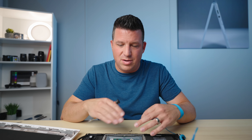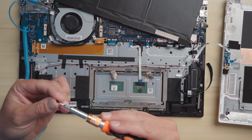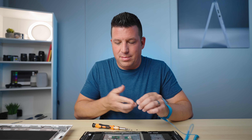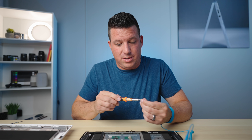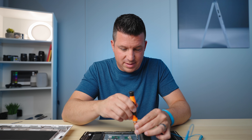It's hard to tell whether you've nailed it perfectly, and that's just the painstaking part of this process — you have to put it back together to test it, because you can't really test it without reassembling, since the battery pushes on everything and it all has to be screwed back in. If you get into this, you'll probably make a very small adjustment, put everything back together — you don't have to replace every piece of tape or put the bottom chassis on — just flip it over and try it out.